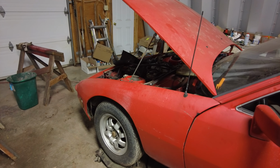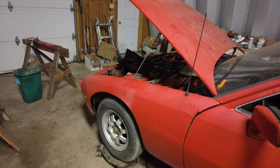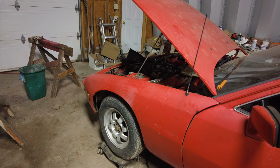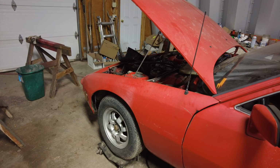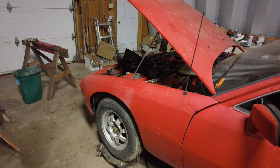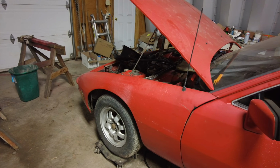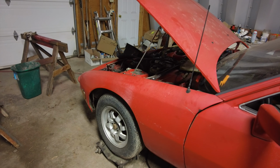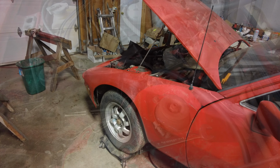I'm coming back around to fuel pressure again. But it's hard to... Oh, I don't know. I'll pull out the... whatever you call those things, the injectors, and see if they're actually getting anything going in. Because it seems to pressure up and have enough pressure there for the first crack, and then no more fuel. So something's going on either in that Jetronic thing or somewhere. Maybe I've got something wrong in there. You never know with me, eh? Do it 3 times. Get it right.